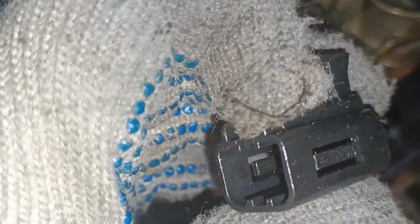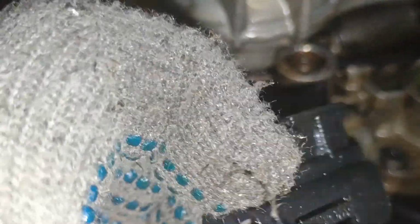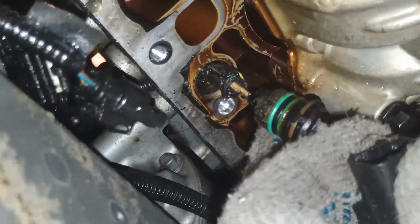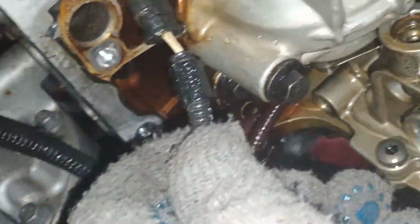You can try to press it from inside, but I did it from the outside, from this one. Just get it away, and this one to the other side, basically left and right, and that will allow you to remove this bracket and leave this socket plug on its own. Right now we will be able to remove this cable away through this big hole like this. Otherwise you will not be able to do that, because this hole is not big enough. Even now, see, and yes, now you can remove that pump easily.